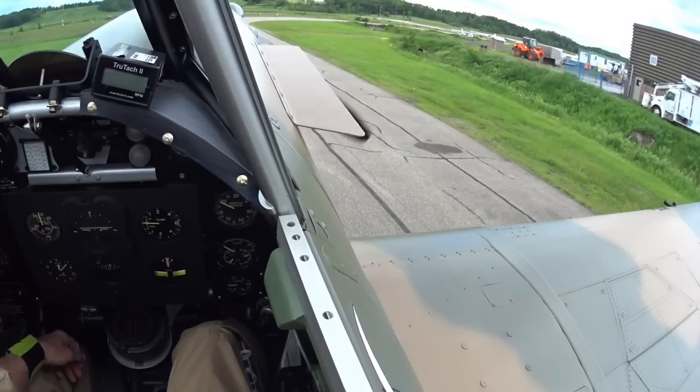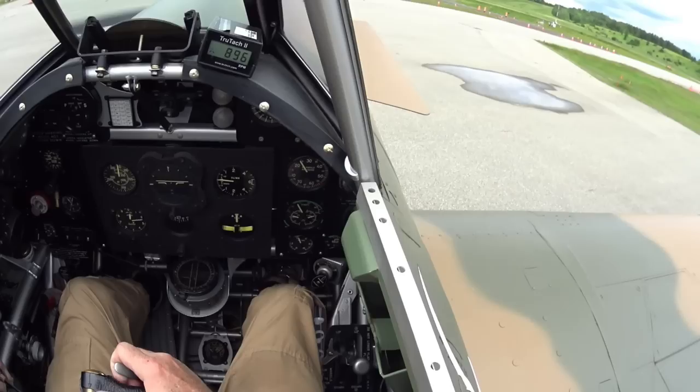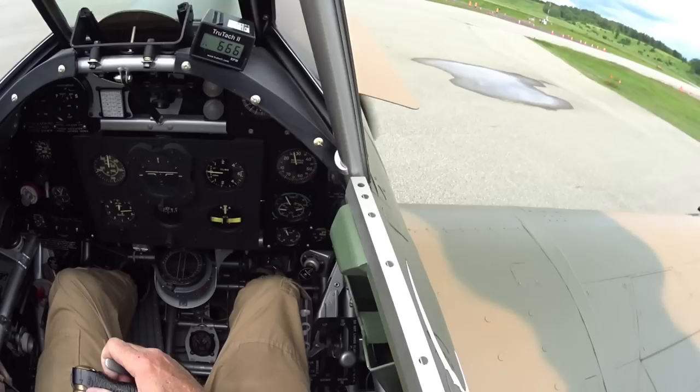And the three after-start things in the bottom right-hand corner of the cockpit are oil pressure, starting mag, and primer. For the run-up, 1900 RPM is no problem. For the cross-check, 890 on the true tach gives you about 1900 RPM. The tail doesn't want to lift if the stick's back, and the airplane won't creep forward if the gauge shows you have good air pressure to each brake.